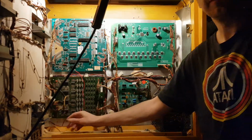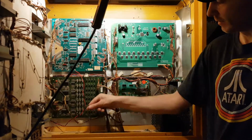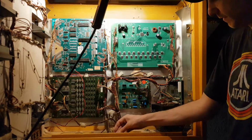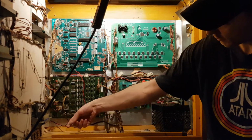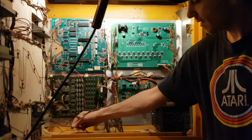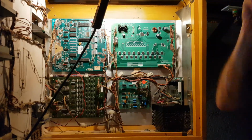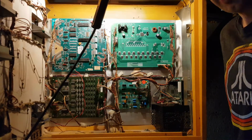And then a lot of times people will forget. Feel around in here, because you want to attach this ground strap. There's a screw right here, Phillips screw. It's going to the existing ground straps, so you're tying into that. And so you just screw that onto there. I'm not going to actually do that because I actually have to remove this head now that I've done reconnecting it. It is going out the door today.